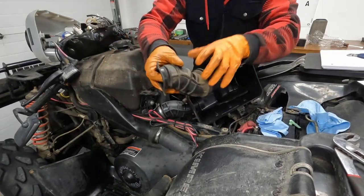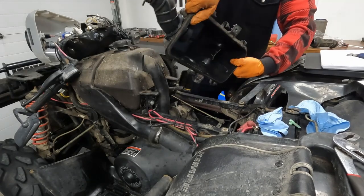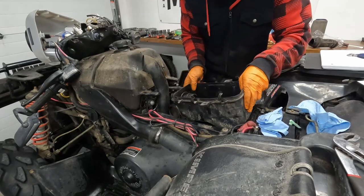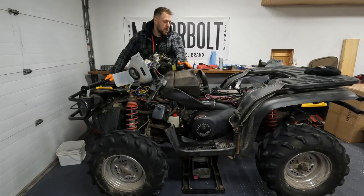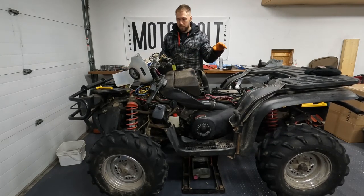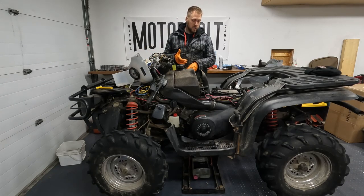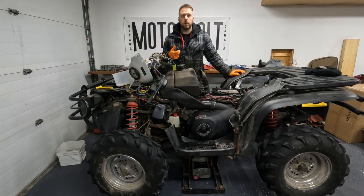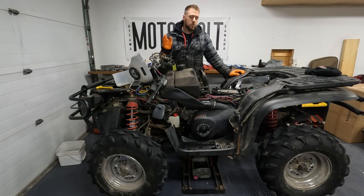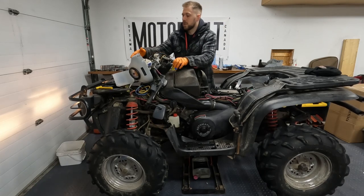Before we put the air box back on, we found that the intake hose is all ripped and in rough shape, so we replaced it with a new one and cleaned the inside of the air box too. We got all the major parts on now - the exhaust, intake carb, air filter. We tied up all the coolant system and filled it with water for now. We're going to try to start the engine and see if everything runs well before putting all the body parts back on. The reason we ran with water is to clean up the system and get rid of the oil that got into the coolant - drain that, then put fresh coolant. Same with the oil - put some cheap oil in, run it, drain that, then put fresh oil. Let's try to fire it up for the first time.